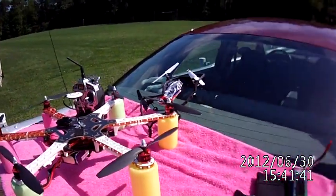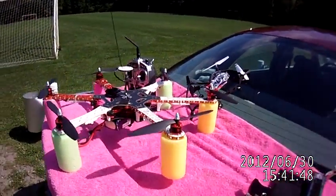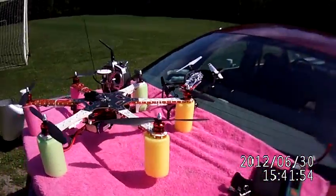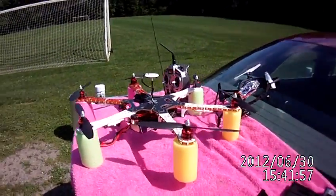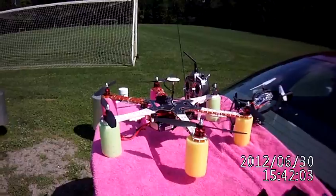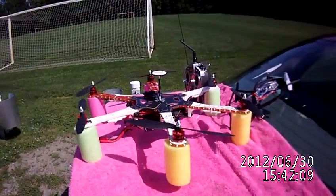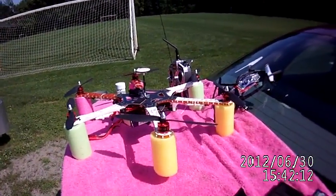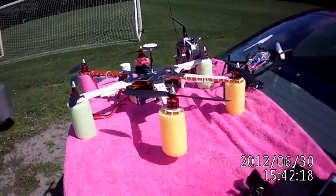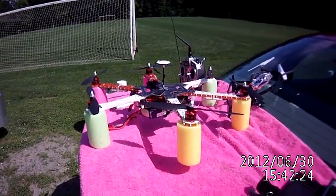So what I've done is I purchased a set of Monto props. These are carbon-filled plastic props — not carbon fiber props, but carbon-filled. Very stiff. I haven't thrown any off yet. The only thing I had to do was modify those — I had to ream them out. I believe it was an 8mm prop shaft ream. There are insert rings that go in those props for the lower half of the prop body, like little adapters that match up for different size props. I'd rather have a solid core, but it is what it is.